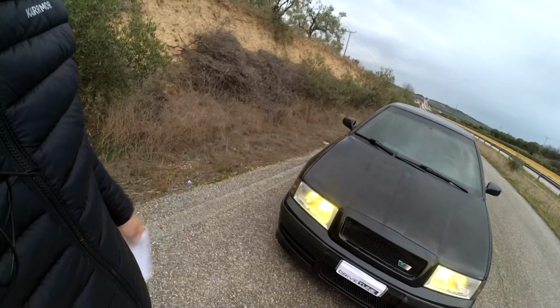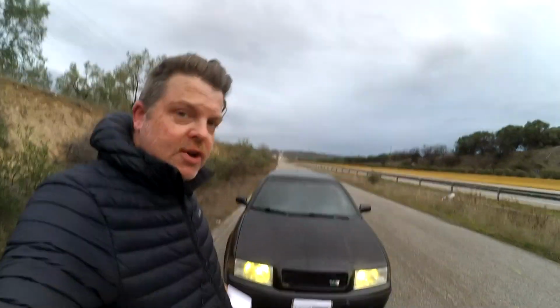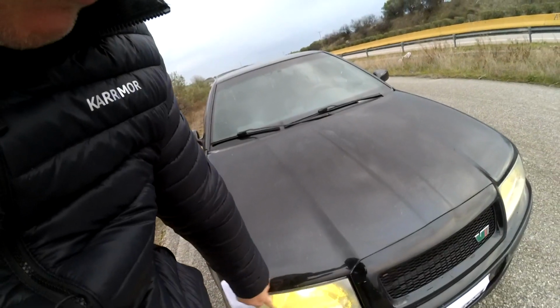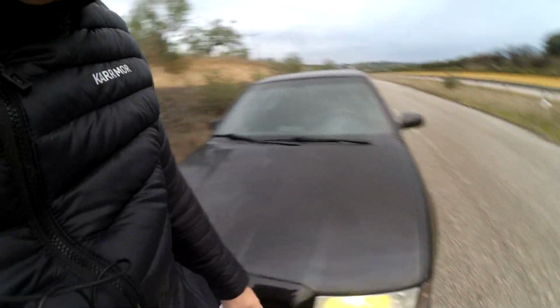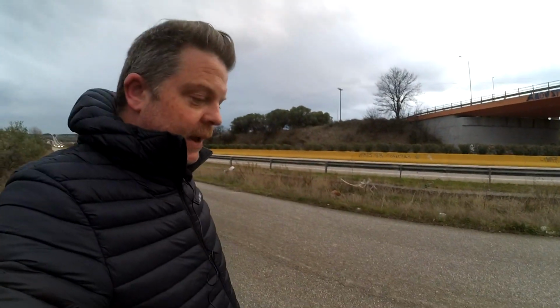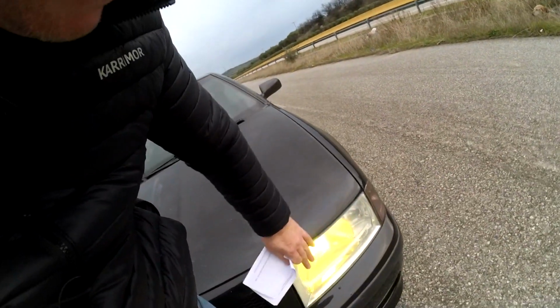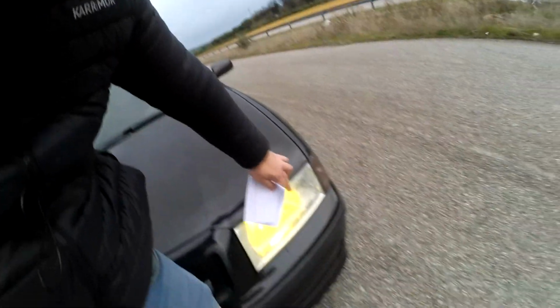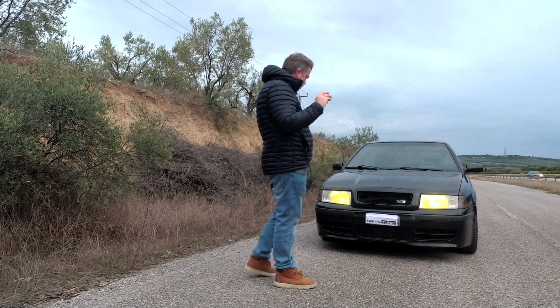And while it did the job, there was one issue with it, and it's kind of my fault. Well, it is my fault because I'm the one that did it. But on this headlight, it's fine. It's as good as it can realistically be, I think. But on this one, it is not great. Basically, I just put too much pressure on that flapper wheel when I was sanding the headlight, and that left little gouges in the cover of the light. I mean, they're not deep, but you can just about see them probably through the light. So it's not a perfect finish.